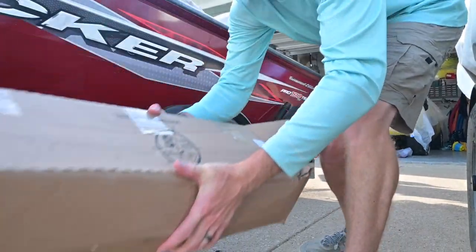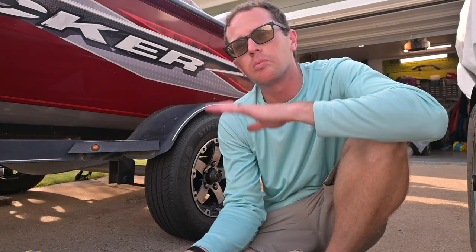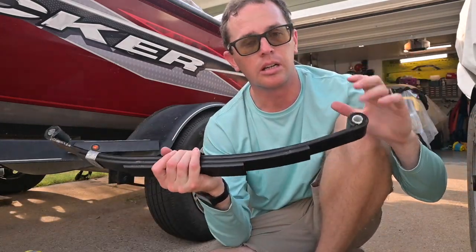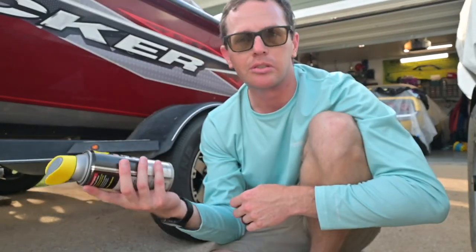What we're going to do today is swap it out with a three-leaf pack that I picked up from Amazon — I'll put a link in the description. These springs are three-leaf packs; you'll find some three or four leaf options. I went with three because I could probably maintain my stock u-bolts, and I don't want an overly stiff spring rate. It's a little bouncy with the mono leaf, but I don't want to go too rigid because then I'm pretty much shock-loading everything. I also don't want to raise the trailer any more than necessary, because that means you'll need to put more trailer in the water to float the boat off.